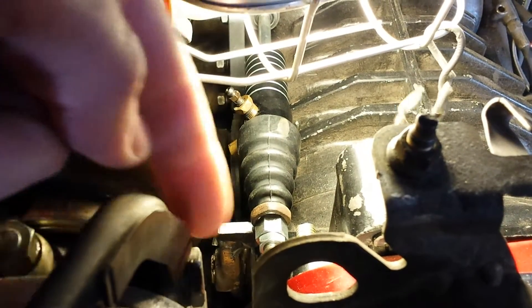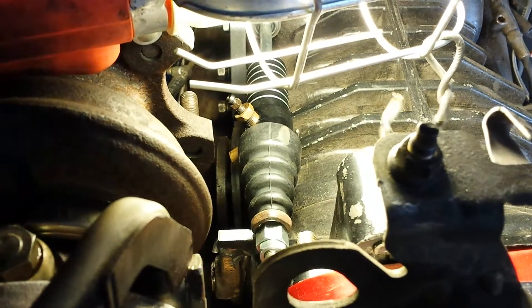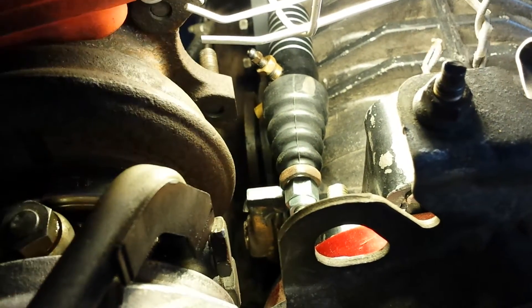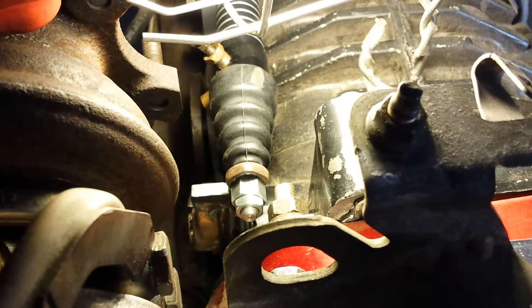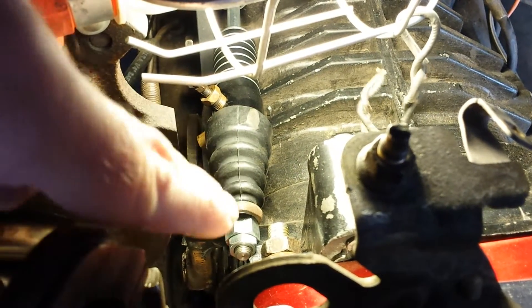So this right here and down here — this is your clutch lever. That's what actually pushes on the pressure plate fingers. So I made a piece of steel go here, and I cut this eyelet off the top, and all this is welded together with my TIG welder, so that the whole slave cylinder — which used to be here — is now down and lower a bit.